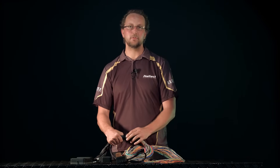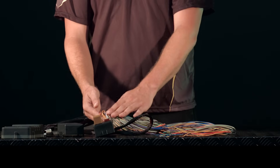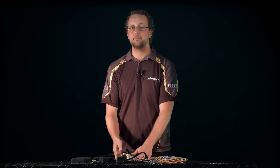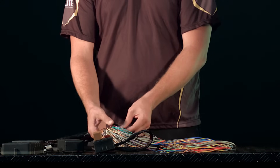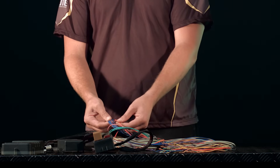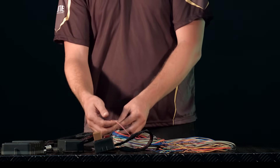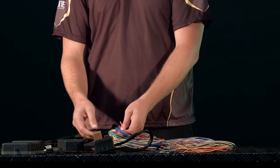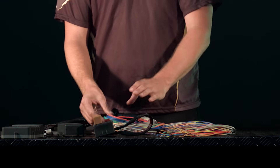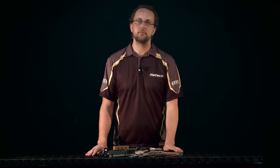Moving further down the harness, there's a 52mm grommet to protect the wiring harness as it passes through the firewall. Past the grommet you'll notice all the different wire colors — every wire color is coded and listed in the Haltech wiring diagram. It looks like a lot of wires, but once you go through the wiring diagram it's not as daunting as it looks. Each group of wires is also labeled; for example, the injector wires are grouped together with their power supply. There's a pink switched 12-volt ignition wire, and green idle control wires — four of those going to a four-wire idle control motor. Any wires that don't get used in your application can simply be pulled out of the harness and set aside.